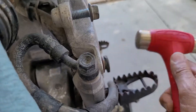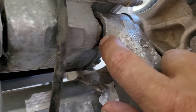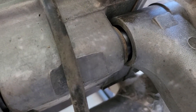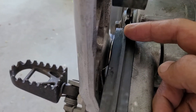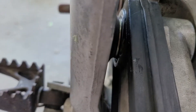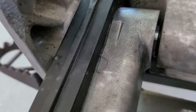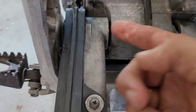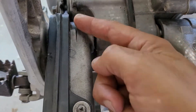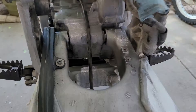When the swing arm's in the bike, remember our inside seal is in here. You can see that gap right there — that opening is where dirt gets in. The reason the chain side wears out so bad is the chain picks up dirt, forcing it down in here against that inner seal. You've also got dirt going down this side. That's why the dirt builds up in there, or when we pressure wash the bike with a nozzle we force dirt into the seals.